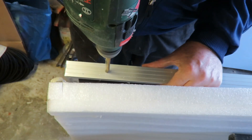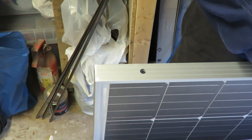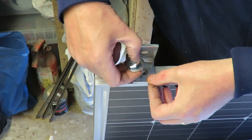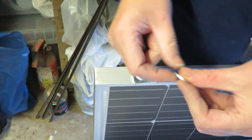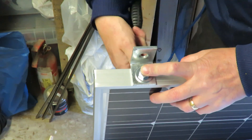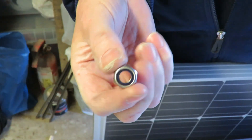You don't want those nuts coming loose. Here I'm drilling a pilot hole in the panel frame and then going through with a 10mm drill. I'm using M10 bolts and nuts to mount the bracket — putting a washer on first, then the bracket, then a normal nut followed by a nylock nut. The last thing I want is these panels coming off while I'm driving down the road. Once mounted, the underside nuts will be very difficult to get to, so I want to make absolutely sure they're rock solid and not going anywhere.